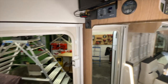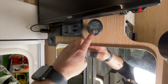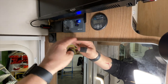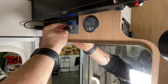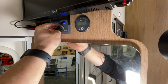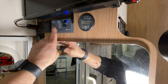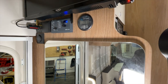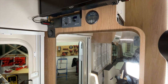Then we installed our displays here. The inverter display and the battery computer. The inverter is relatively simple – flip to the right: on. Then all sockets are supplied with 230 Volt. Here we can also set a shore power limit – I can dial it down to 8 Ampere or 16, depending on what the external socket provides. If we switch to the left, I can activate charger-only mode, so the unit only charges and there's no 230 Volt on the sockets. In the middle it's all off.